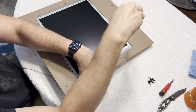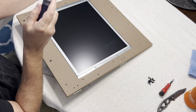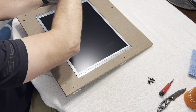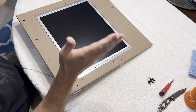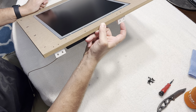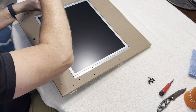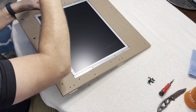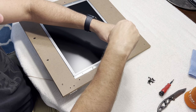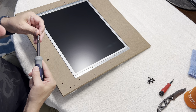Then you don't have to worry about taking the monitor back out of the cabinet, which was the biggest pain of doing it. On my Joust cabinet I was able to loosen all the screws on both sides just till they were outside the cabinet — not completely out, but where the head of the screw was just above flush — and then pull it apart a little bit. Undo the screws on where the plastic hits the cabinet, not from the monitor itself but from the sides of the cabinet, and then work the monitor out without having to take the side panel off.